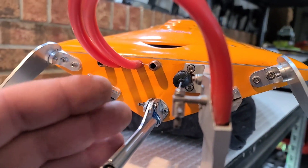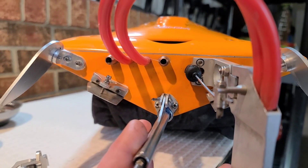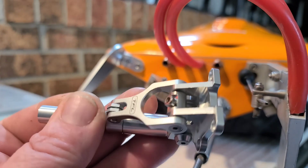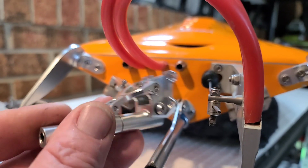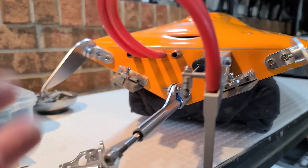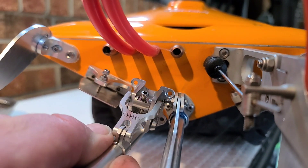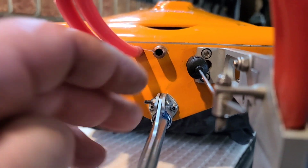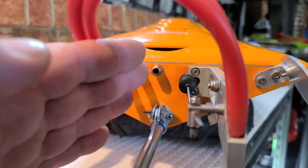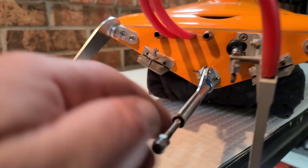It's been great on 4s, but when I throw 6s in it with a pitchy or a big prop, she wants to torque the whole stinger over with all the power. Hopefully this new stinger will alleviate that problem. It's got an adjustable strut barrel — it will unscrew in and out for tunability, and it also adjusts up and down like any old stinger. Super nice, pretty heavy duty looking. The part number from Offshore Electrics is 5B1132 — should be a great upgrade for this boat.